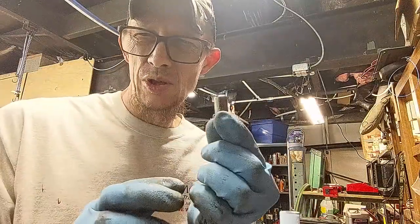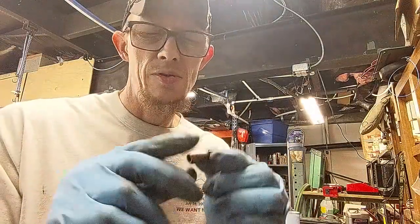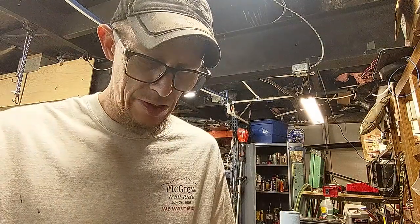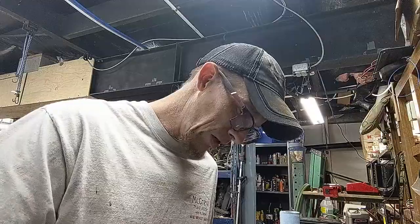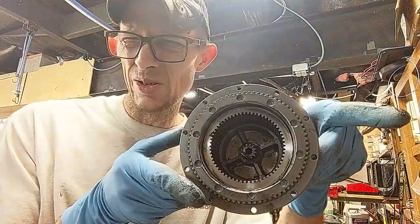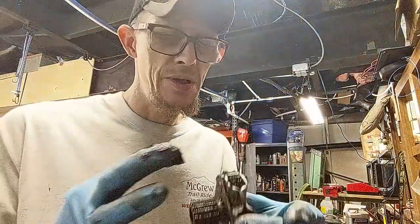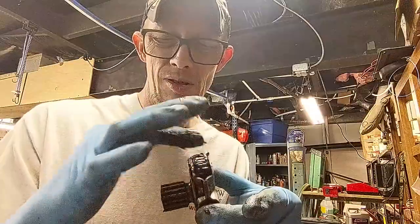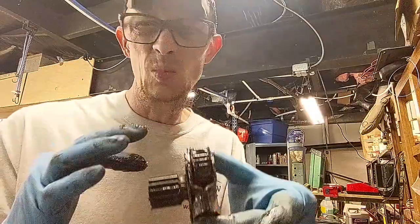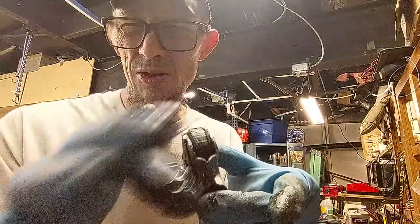The next piece that goes down is going to be the sun gear - this little guy here. It rides down in that bronze bushing, so you just want to make sure that this is lubed up pretty good. Probably wouldn't hurt to stick some down into the bushing. This gear is hollow as well. The brake ends up in this hole. You don't have to get crazy - you can use a paintbrush or whatever. I'm just putting a little bit on my finger. You slap it in here, turn it around, and just make sure all the gears are coated up, but we're not getting real stupid with it.